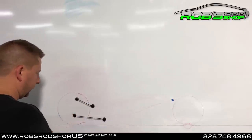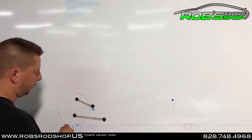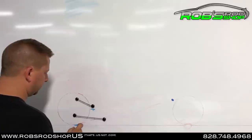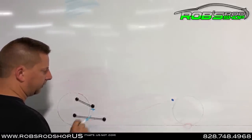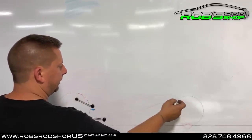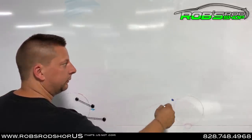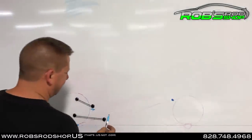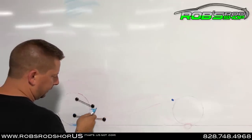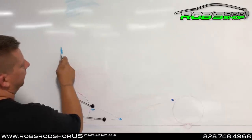This is the rear tire and this is what's driving the car forward. This is the point at which it contacts the ground — the point that the car will be pivoting on if it does decide to wheelie. This is the push point; this is what makes the car go. This is all we have: this contact patch between this rear tire and the ground pushing the car forward. This imaginary line from the bottom of this contact patch to the center of gravity — which is generally about camshaft height, about the back of the block. If you take this lower bar and it's angled in this direction, you tie these together — this is our imaginary push point. We're pushing below the center of gravity, pulling the rear tire up off the ground, pulling the back of the car down and squatting essentially.